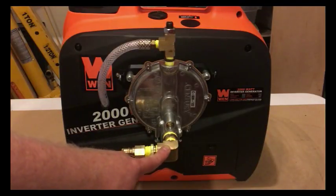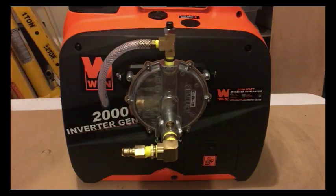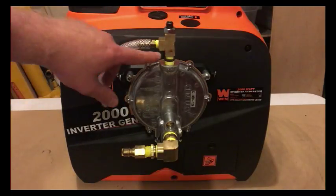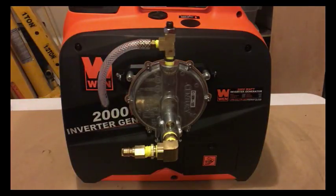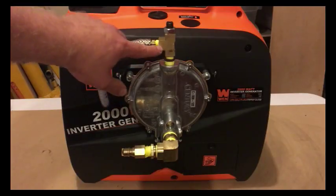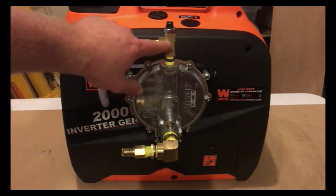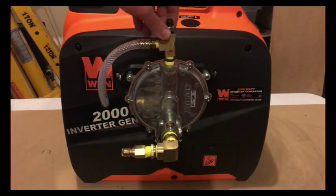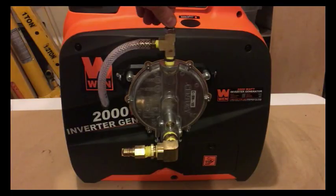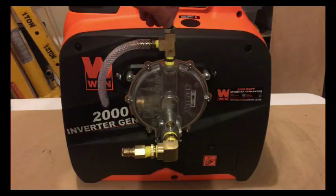You can see I've got a 90-degree elbow here — you don't have to have that, I just chose to put that in so the gas line would come out the front, but you could skip it. Up here at the top, this is the valve that regulates the gas flow into the motor, commonly referred to as a load block valve. Most kits have these; they're like $30–$35, kind of spendy. This one I basically made out of a T-fitting with a set screw and a lock nut, which gives you the ability to regulate the amount of gas. You can also use a $6 ball valve from the hardware store. The load block valve just gives you a little more fine-tuning to open, close, and lock it down.